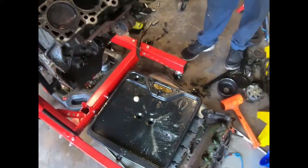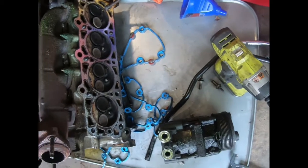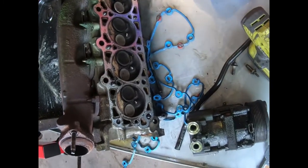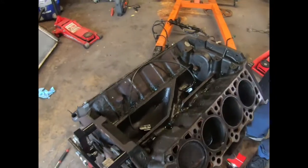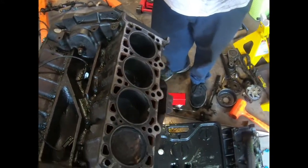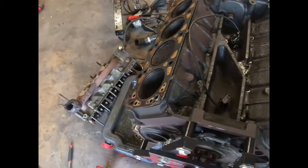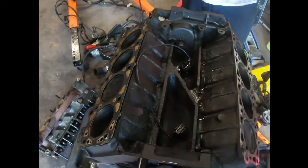It would need new, if I had to guess, just replace the valves and resurface the pistons. We could have done all that. Probably have some room to put this motor somewhere, probably can save it somewhere. I don't know. But he probably can sell the heads, put them online. The heads are still good. Heads are not warped. Car never overheated. But somebody told me the heads are worth money, but the blocks are not.